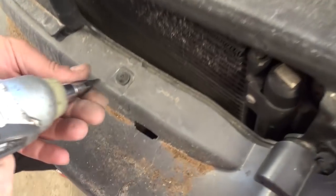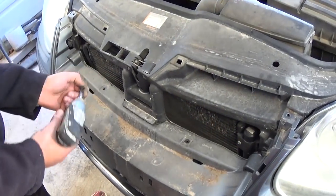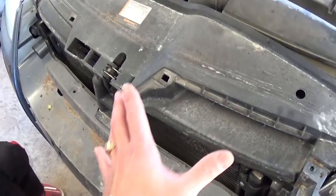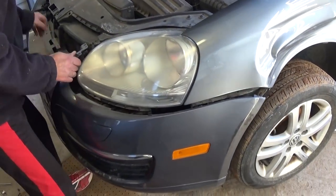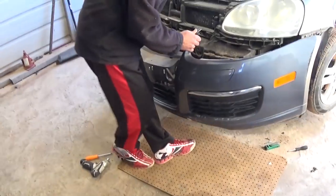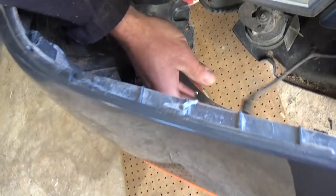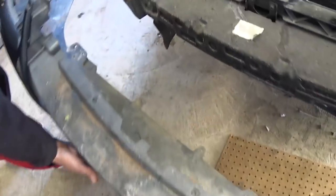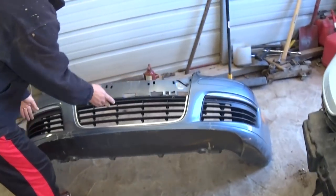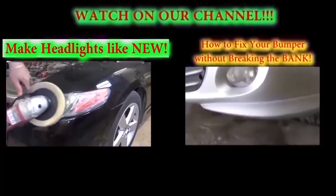Once we've removed all of them on the bottom, next with the T25 there are two more screws on top of the bumper under the grill — that's where the grill covers them. Now you have to be careful because nothing else is holding it. If you just pull on it a little bit, it's going to come out of the side slides. The bumper cover will come off. What we need to do now is unhook all the wires — we have the turn signals right here, so pull the wire out. If you have fog lights, undo those as well. And that's how you remove and replace it, guys. Pretty simple procedure. Thank you for watching — don't forget to subscribe and give us a like. We have a new video on our channel every day.